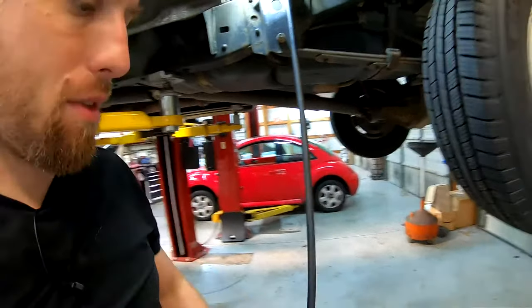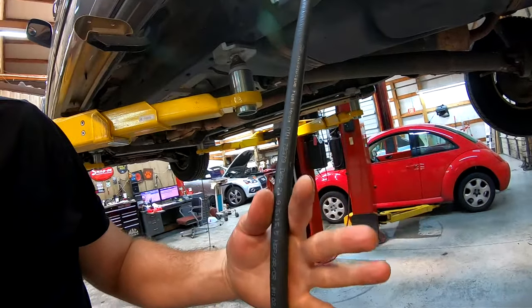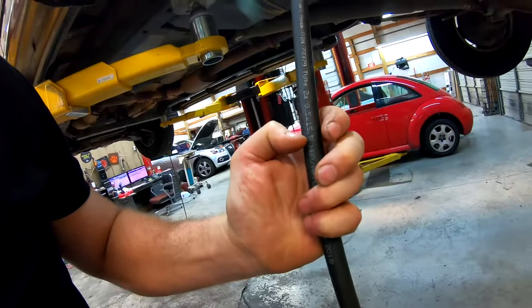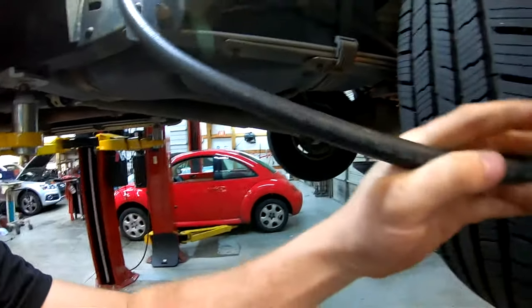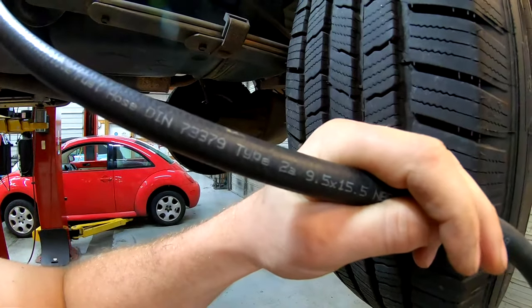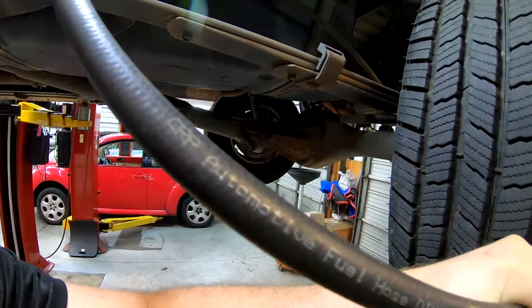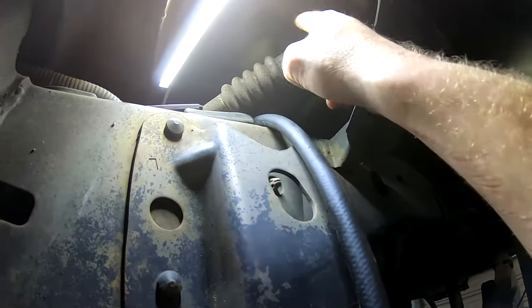Fuel line. I can tell you what size. It is 9.5 by 15.5, 2A. I don't know if you can read the part number on there. Automotive fuel hose. This will work to replace that plastic line that goes from here to the other side, because